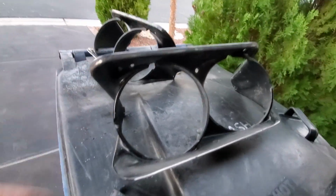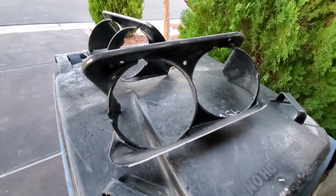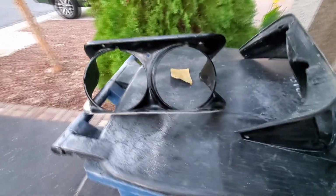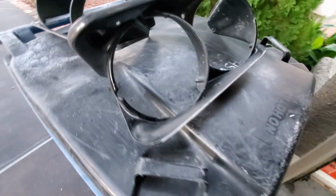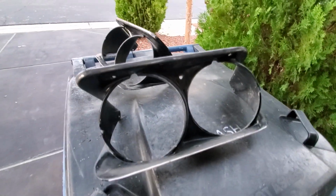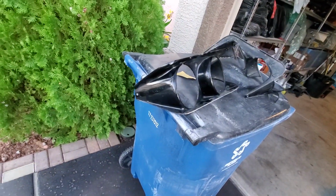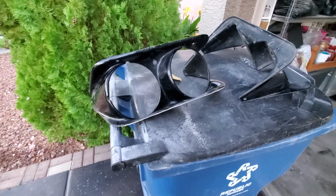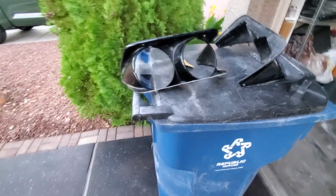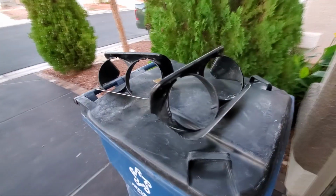Alright, so for my headlight lenses, or shell, or whatever you want to call it, I'm going to just basically scuff, buff, primer it, and throw it back in, because these aren't too bad at all. So that'll fill it in with the primer and everything. Another part that's pretty much hidden, you only see it when the headlights are up at night. So they don't have to be perfect at all. So yep, that's what we're gonna do.